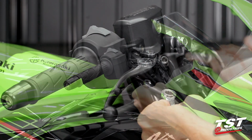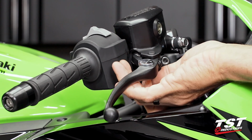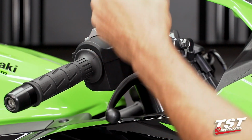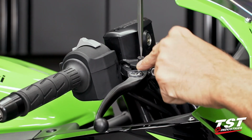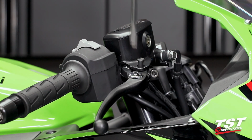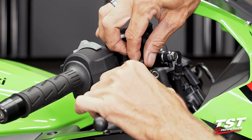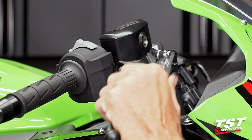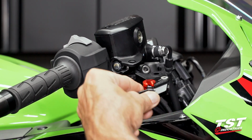The nut is located here on the bottom, right below this pivot bolt. Once you crack that loose, it comes off by hand. Then we grab our flathead screwdriver and spin this out. Once the bearing portion of this pivot bolt clears and the thread comes out of the bottom, we'll continue just spinning in place. Grab the lever, wiggle it just a little bit, and pull the pivot bolt out. Lever comes off.